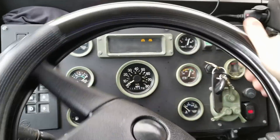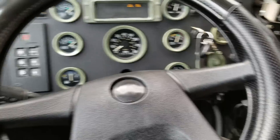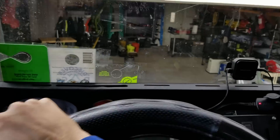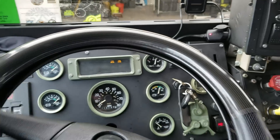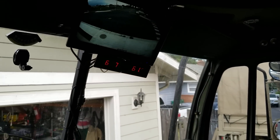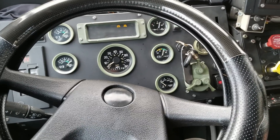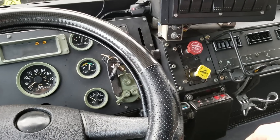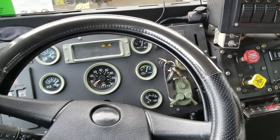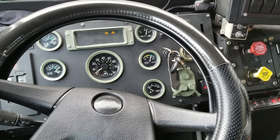It seems like everything's back to normal. The steering effort is decreased quite a bit at idle, and the air conditioning is blowing out super cold air at idle. When you bring the RPMs up, everything stays at the same effort level and the AC compressor obviously picks up some BTUs. I think I may have solved it — fingers crossed. I've gained back some of the flow lost from installing the air conditioning system, and I don't see any more leaks — nothing blew up yet, which is a good thing.